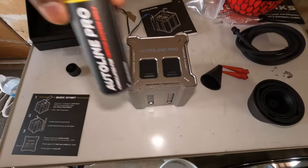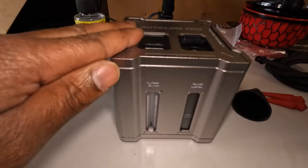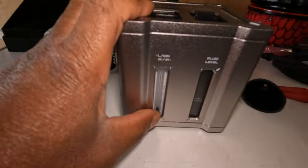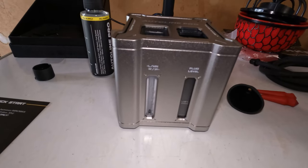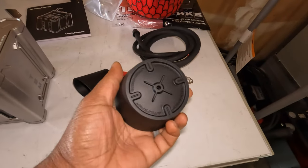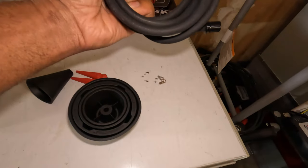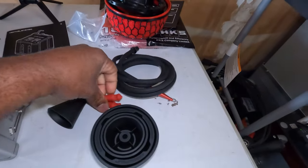Alright, seems pretty straightforward. We have our smoke fluid — we'll pop that in here, and it has a max fill line. It has its own little air pump. The gauge reads zero when there are no leaks, but if the gauge moves up, there's a leak somewhere, so you've also got to listen for it. We've also got the cones — this will go onto the intake runners to plug them up, and then you add the fitting to the end.